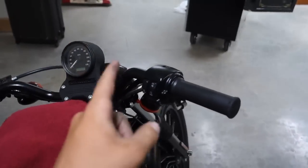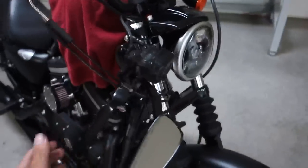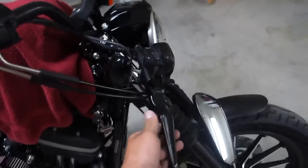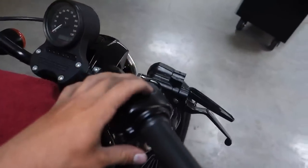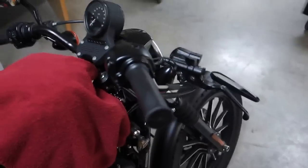I just took off the brake right here and I'm letting it hang there as you can see. Just remove it from here and let it hang on the wires for now. The next thing we're gonna do is remove this T27 up here and take off that side of the handlebar portion.